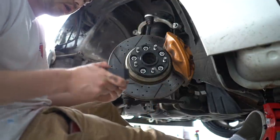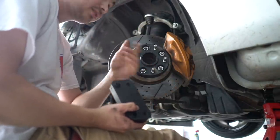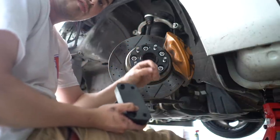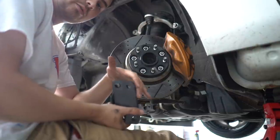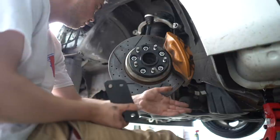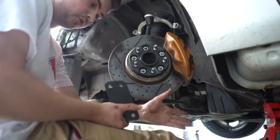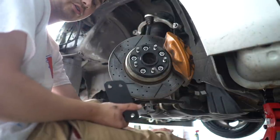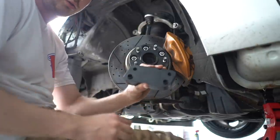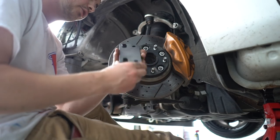I'm hoping this is actually going to fix my caster issue, because since I put in the shortened spindles with those RCAs the caster is so far off it's ridiculous. I tried to adjust it but the stock camber bolt for the caster arm is just fused together with the bushing, so it won't move. I don't really feel like replacing all of that just to fix the caster, so I'm hoping the offset mounting points on this will fix my issue.